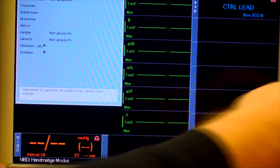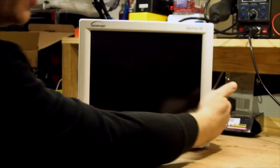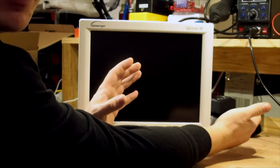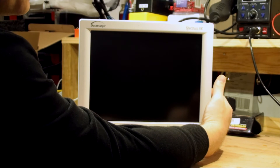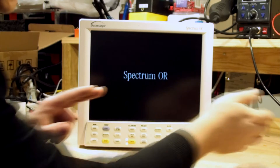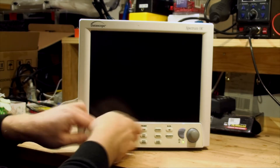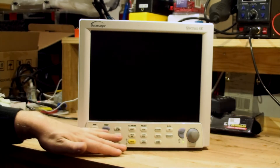The service manual says to get into the service menu: turn the machine off, hold down the trends button, then turn the unit on while holding it until you see the logo, then let go of the buttons and it should go into the setup menu — for country, language, time format, all that. But this unit doesn't go into it. After trying, the logo appeared, I let go, and what we got was just beeping. No response from any buttons, so nothing. Had to turn it off.